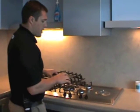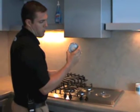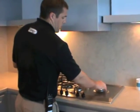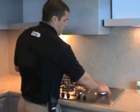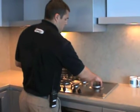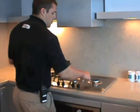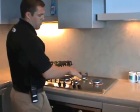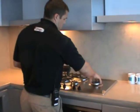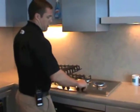When you put the burner back on, you'll notice at the top there's a little hole at the top of this burner. What you want to do is put this white peg down through that hole, and then give it a little wiggle to make sure it's on nice and secure. Same thing when you're putting the top back on — give it a little wiggle. If your top's not on straight, you'll notice because the flame comes out crooked and doesn't come out nice and even. That's how you can tell if it's on straight.